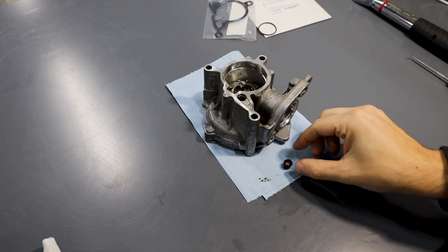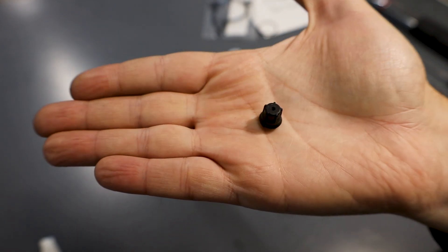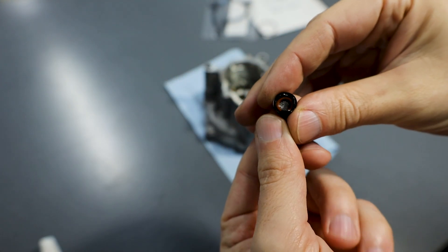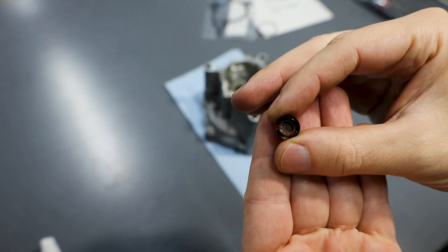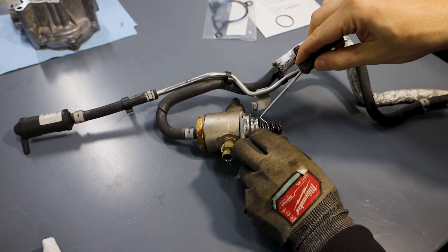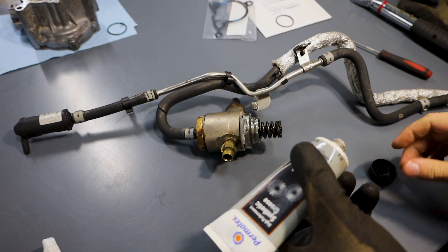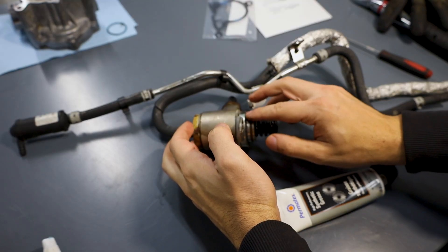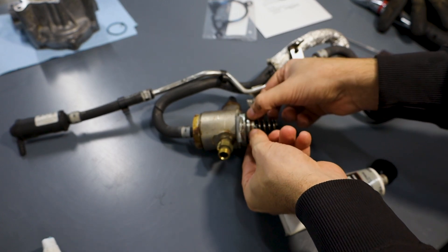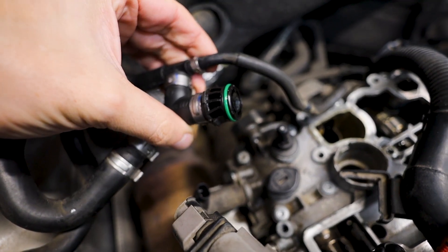Another thing you'll probably notice me doing in all my videos is I always break fasteners loose by hand first and I also tighten them down by hand. There's just been too many times where tightening with a power tool you don't notice that little bit of thread resistance that indicates you might be stripping the threads or any other bad news. I like to seed it and get things exactly where I want them before I put down final torque. As promised I also spent some time cleaning out the oil screen that fits in the little bucket right there — that little pile of schmutz is what came out of it. I wanted to show you something: you might think there is no hole on the back side but of course there is — it's a very, very tiny hole. So if there's any clogging going on in here it's going to have a significant impact, so don't neglect this screen. And of course at the same time we'll take care of the o-ring on the high pressure fuel pump. In these particular cases I actually prefer to lube up my new o-rings with a little bit of synthetic grease — it's a repellent of sorts and a lubricant as well, and it helps the o-ring slide on without twisting on itself.